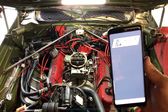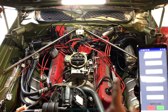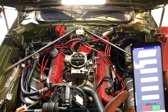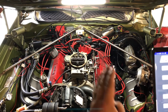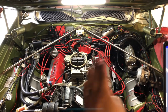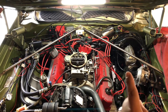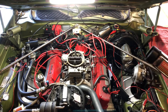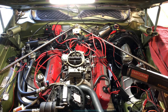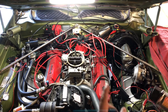Now we bring up the app — this is the heart of the system. You press connect to pair via Bluetooth with the distributor. You can set up what's called a starting point table based on your engine size. It creates a timing table to work from so the engine can start and run, and then you can adjust parameters from there. We're going to verify with a timing light that we're at 10 degrees before top dead center while running, adjusting the distributor slightly if needed before tuning.